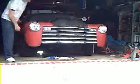Now the bolts inside the fender typically are rusted and come off difficult. Sometimes you can unbolt them, sometimes you just got to cut them off. When you're cutting them off, you want to go between the head of the bolt and the washer. You don't want to go past the washer, you don't want to cut into the metal of your truck, you just want to cut the head off the bolt. So in between the head of the bolt and the washer, so that the washer gives you a little bit of room between your sheet metal there. So I'm going to cut these off because I'm getting tired of screwing with them.